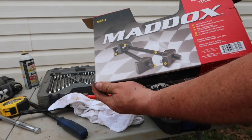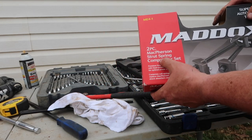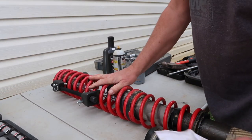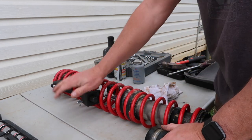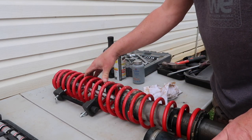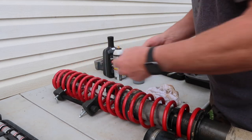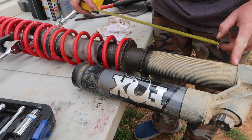So if you go to Harbor Freight looking for these, this is what I used — a really neat two-piece McPherson strut compressor set. All right, on to our rear shock. This rear shock is actually the easiest — I guess because it's a longer shock, I don't know why, but it is easier. You don't have to have the spring clamps but since I have them I'm going to compress this spring just to make it easier to work with, then change my tender spring and walk you through those steps.